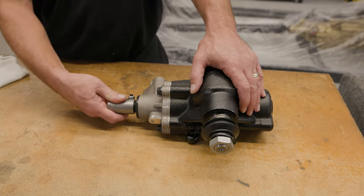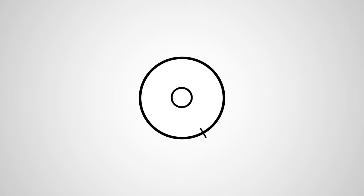Center the gear on the bench before it is installed. Turn the input shaft all the way to one side. Turn the gear all the way in the other direction and count the turns. Turn the gear back in the opposite direction half the number of turns.